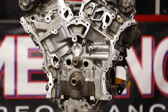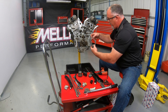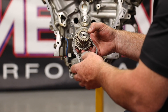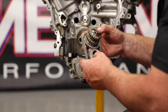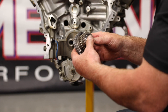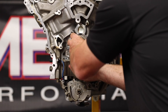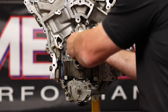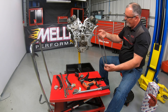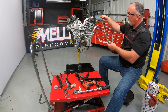We've got all that off. Now we'll take our crank sprocket — we want to take the blue link on the chain and line it up with the timing mark on the sprocket. These timing marks can be hard to see especially if the lighting's bad, so I like to take a paint pen and just hit them with a yellow paint pen so they stand out a little bit better. When we put this on we want to make sure that the timing mark on the idler sprocket is at noon — it doesn't really matter what time zone you're in, just noon. Once we get that on we'll put the bolt in just to hold it, then start wrapping our chain to the left bank. We've got two blue links and one gold — the gold link is going to align with the timing mark on the idler sprocket, and the two blue ones are going to hit your timing marks on your camshafts.